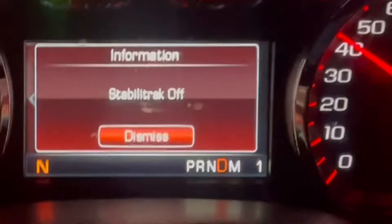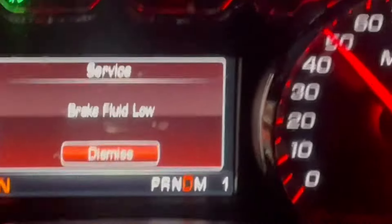We've been having a lot of issues on the dash when we stop and go in this truck. The lights go away, they clear themselves, and then at the next stoplight they come back again — brake light, low brake fluid, ABS, traction control, all this stuff going on. We're on the quest to figure out if it's a ground issue, a module issue, or a relay. I've been reading some forums but I want to take you guys through it — maybe you can help me out, like we did early on with the cold Duramax won't start video that helped thousands of people.